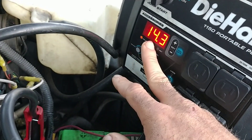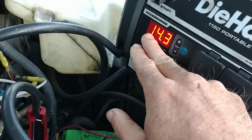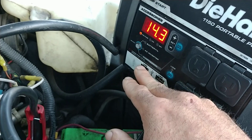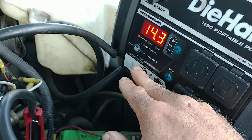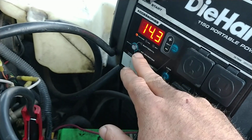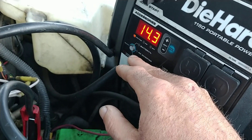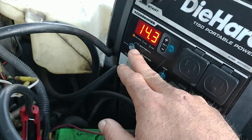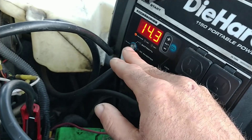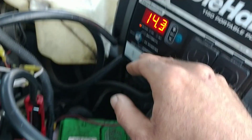If you start getting 10.5s and 10s — even if the voltage when you go to start it is reading like 13 volts — if it drops below 10.5, that means that battery doesn't have the cranking amps that it should. There's a big difference between voltage and cranking amps. A battery that drops below 10.5 while cranking is one you wouldn't want to sit with your ignition on listening to the radio. You're really going to see the effects when it gets cold out, and that's what's happening now. It's getting cold out and this battery is no good, but I'm going to show you why.